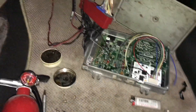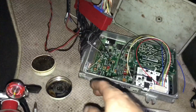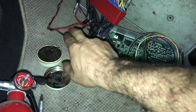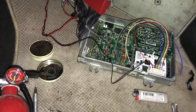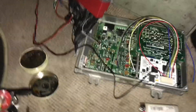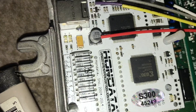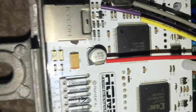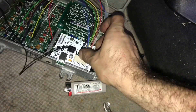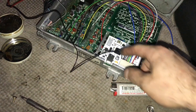Once you get it all wired up, run your wires into your engine bay where your ECU is, through the firewall. I was using the red wire for power and black for signal. On the serial port in the Hondata, you put the output where it's listed as A and O — you can see it right there. The wire is black, so I was just trying to keep the colors consistent. Take your serial wire harness and put it in to A and O.